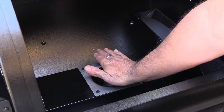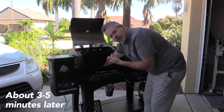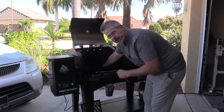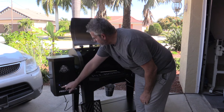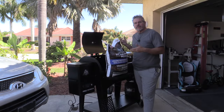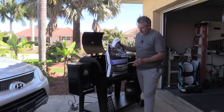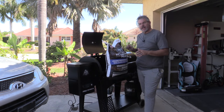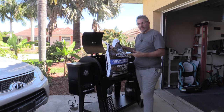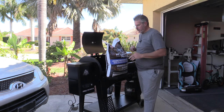There's a little heating rod down inside of there. As I hold my hand here, I feel that air blowing and I also now feel it to be a bit warm, so I believe that heating element is now heating up. We'll go ahead and turn this back off — turn it to the off position and turn the power off. You can still hear the fan running; this is sort of a shutdown mode that it goes through. I'm now going to go ahead and put the pellets in. Again, this is the first time I'm doing it, following the instructions exactly. You power it on, remove all the grates so you can feel and see it down there, feel the heat and the air blowing — that way you know the heating element and fan are working.